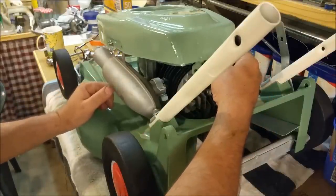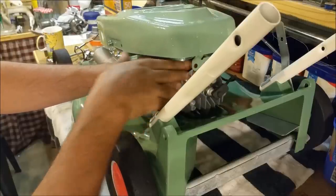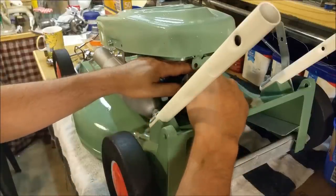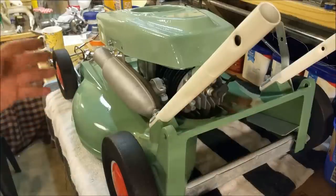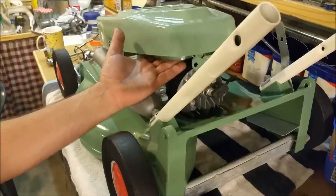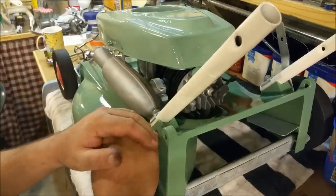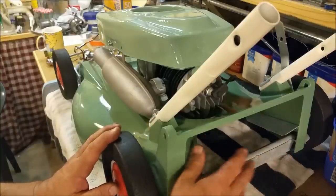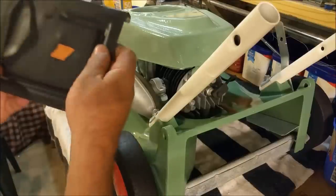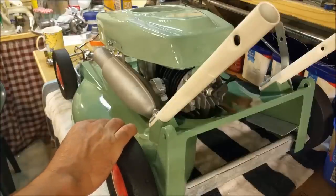But I do have to rework the top to make it fit. What that's going to necessitate is putting studs in here. I'm going to have to shave those fins back a little bit so that'll drop it down on top, and also elongate these holes inward a bit so that everything sort of lines up and tightens, and then that will sit level. There shouldn't be any cooling issues because there's a lot of airflow under here, and it's also got a channelled area on the inside to concentrate airflow. So I don't think that's going to be a problem at all, but it does mean a modification which I didn't really set out to do. That being said, I'm really happy with it — that's the look I'm chasing with this machine. It's got the worst tires on it, I haven't done the catcher yet, and I've got to body work the one with the dent in it. But I'm really, really happy with how this one looks.